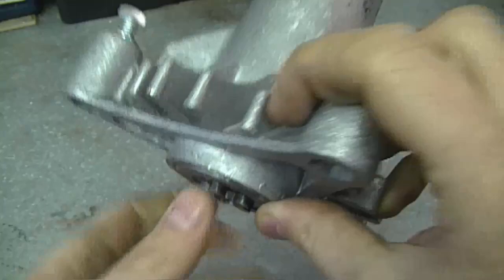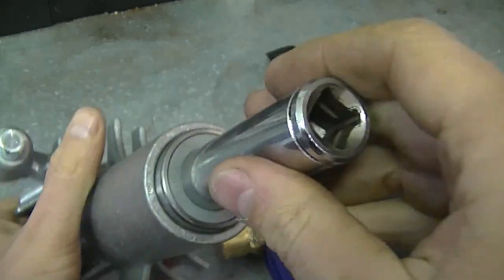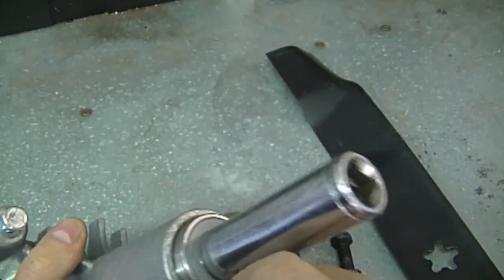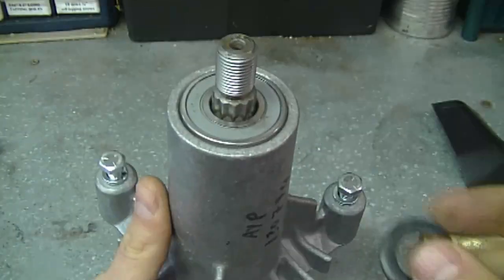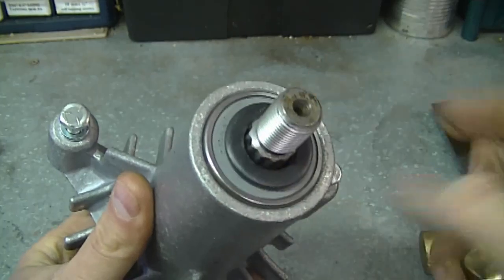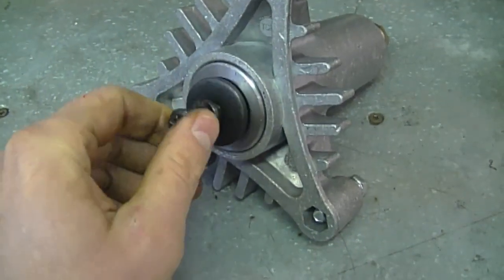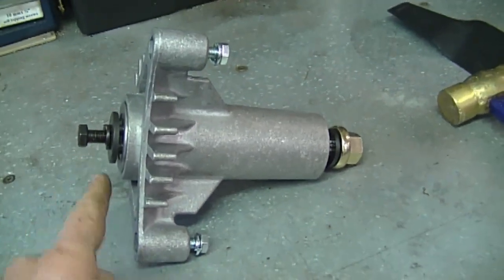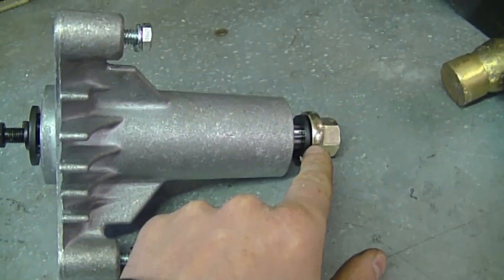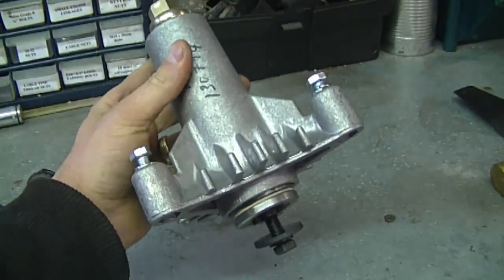I'm going to put this all back into the spindle — it goes flush with the spindle here. Now at the top, the other bearing goes on like this, and to put the other bearing in I'm just going to put a socket here around the inner race of the bearing and tap it in with my brass hammer. Until you need to use the spindle, the washer goes here and the nut, and I'm also going to leave the blade bolt on the spindle as well until I need it. When you buy a complete spindle like this, usually all these parts come with it — all the bolts, the nut, and the washer at the top. That's all there is to all the parts making up a spindle for your lawn tractor. Thanks for watching guys, and I'll see you in my next video.